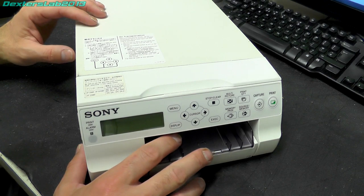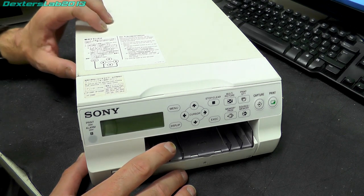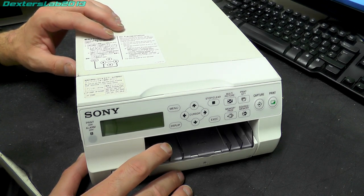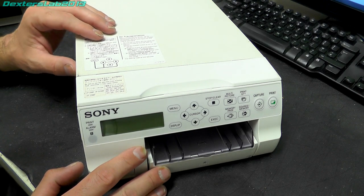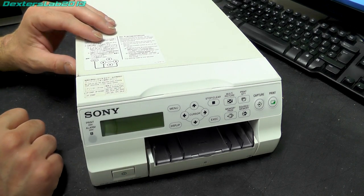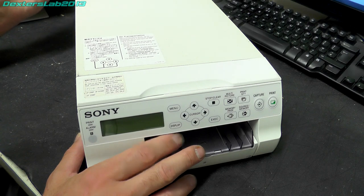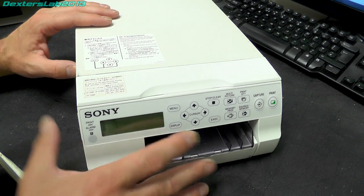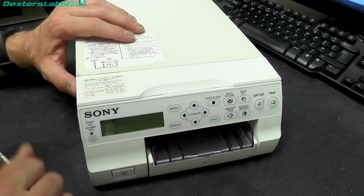Because this has component video input, you can adapt that to VGA. Most video cards nowadays allow you to configure custom video resolutions and can usually output interlaced video formats if you choose to turn that feature on. If you don't have that on your video card, you could use something like a video scaler — I did a video not too long ago about them, there'll be a link in the top corner. So if you can manage to get this connected to your PC and output 1920 by 1080, you'll have access to 2 megapixel prints. On the large paper that gets you 5 by 3 inch prints at about 384 dpi. The quality is exceptional out of these printers, as I'll show you when I do some test prints.